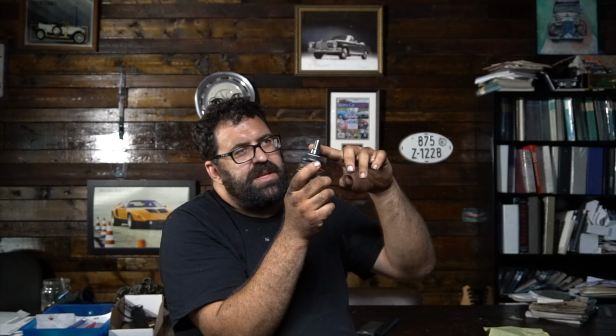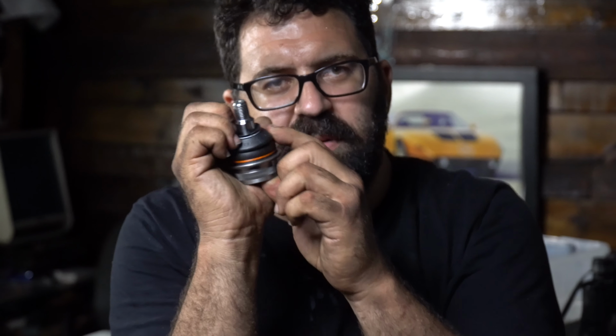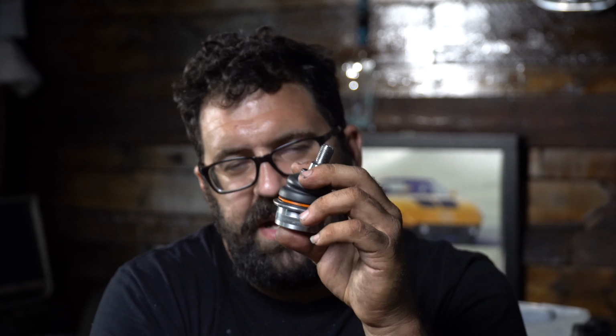This part bolts into the lower control arm with a 22 millimeter nut, so really the only part that you can see is the boot itself. Now, on the Mercedes ball joint, the boot is extremely strong and lasts for a really long time. What I tell people is if your boot's disintegrating, it's time to replace it. And if you see rust and not very much boot left, you need to do the replacement sooner rather than later, as in get off your butt and do it.